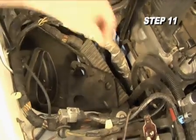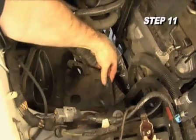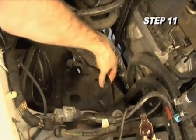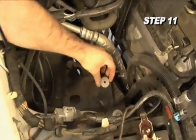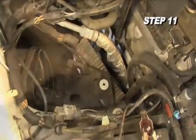Next, install the provided rubber mounted studs onto the heat shield mounting tray. The fender washers should be placed on either side of the mounting tray with the rubber washer in between each fender washer.